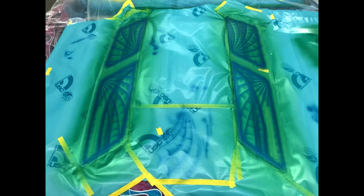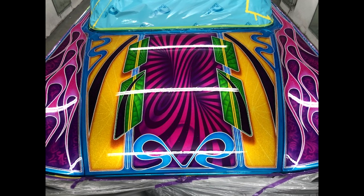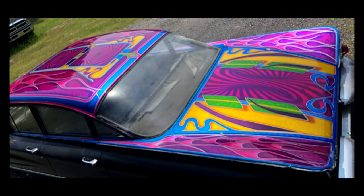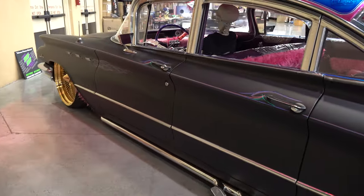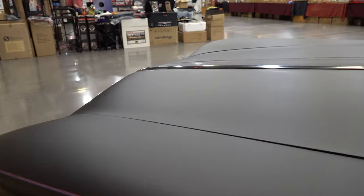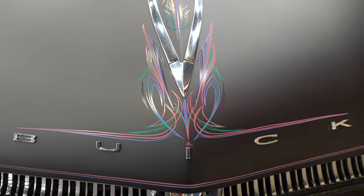How many hours does something like a trunk and hood like this take? Probably close to 400 hours — it's pretty wild. Just the time and thought of doing it, and as you go things change a little bit. This car was around 300 to 400 hours. You're also painting just one area at a time so you don't get paint buildup. You top the metal flake with clear, then do all your graphics, and I try to do all the graphics without putting any more clear on until I'm done. The intercoat clear allows you to stop for a week, lightly scuff it, and start back again.